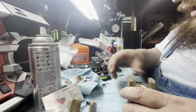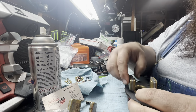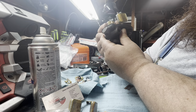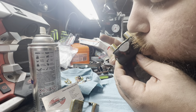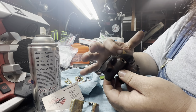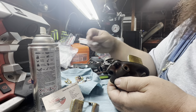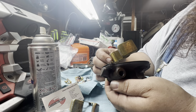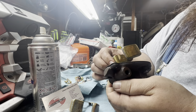They're a little wild. Okay, let that little brass piece go. Okay. Now here's where you do your other thing you're going to have to do, which is adjust the float. So basically how the float works is, I'm going to try and hopefully show you guys this. See, if you blow in it now, nothing comes out. You hear there's no air movement. So when the gas fills up all the way, there'll be gas at the bottom of this. There's ways you use the little measuring tool. They give you this little thing here and you measure some stuff here, maybe, I don't know. And then when it's like that, it doesn't let any gas in, but if the float's like this, where it's lower because gas is getting sucked out and getting atomized and gets lower, then,